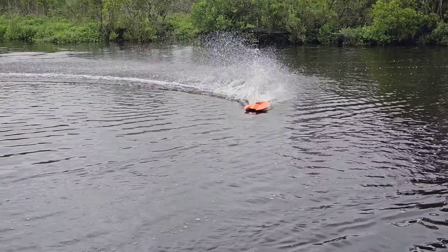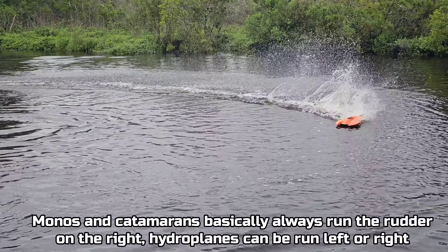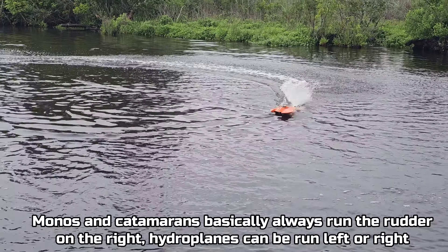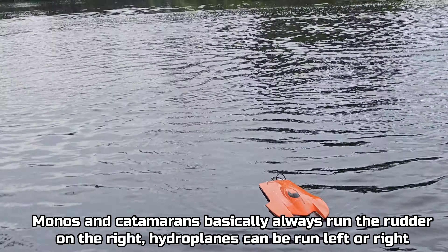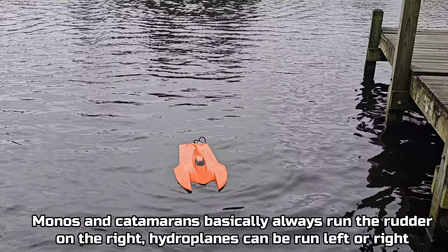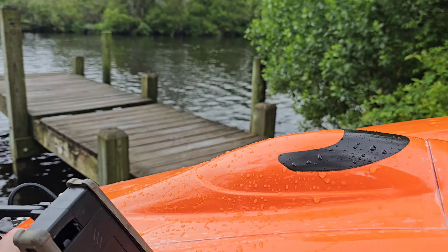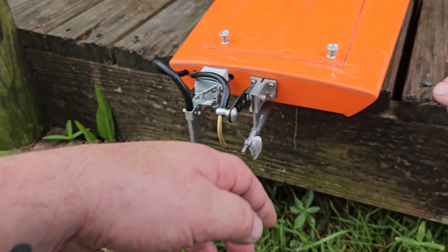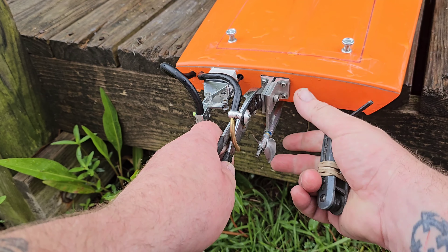The reason I put my rudder on the left side opposed to the right is I wanted it to kind of swing out in the corner — I think they call it crab steering or crab cornering. It gives the boat a different turn characteristic when you put the rudder on the left side opposed to the right. It handled better with the level tunnel — right now the tunnel is angled, but my bench tune worked. It was just rudder placement relative to the propeller.